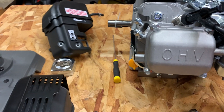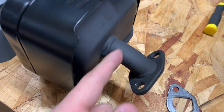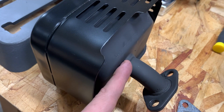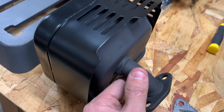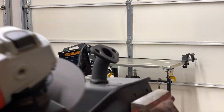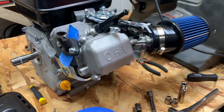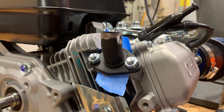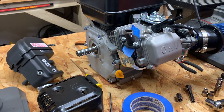The plan for the exhaust is a little unique. The plan is to cut the muffler off of its little header pipe right here at this joint, and reuse this little flange and piece of pipe to stick straight up. Since we know the exhaust is going to stick straight up in the air and can't get in anything's way, let's go ahead and put the torque converter on and then get started on that axle.